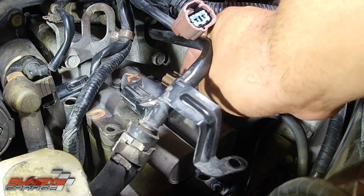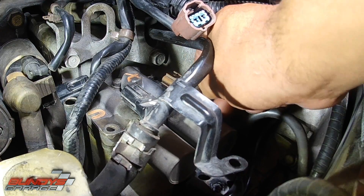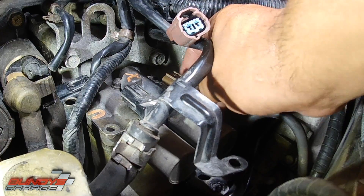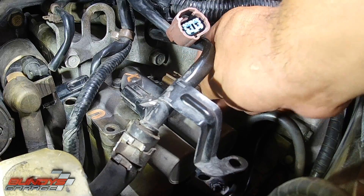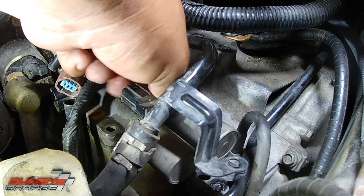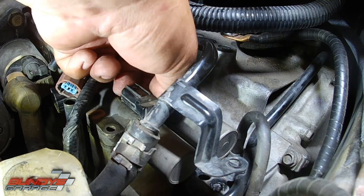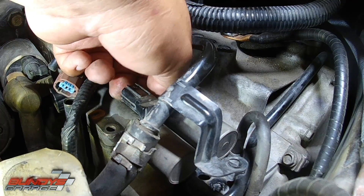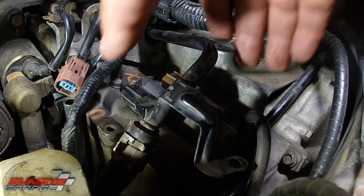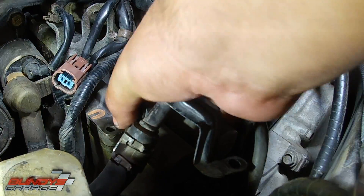I actually put a link in the description below to an article I found that talks about this specific problem. They're talking about comebacks for shop owners that rebuild transmissions, then the vehicle comes back again with the P0740 code. They talk about adding an external cooler, drilling a hole into the valve body at a specific location that helps with line pressure, and a new spring in the valve body at a specific place. So I'm crossing my fingers hoping this solenoid replacement will clear the P0740 code, but I'm not going to hold my breath. This transmission has seen better days — it's probably on its last leg. The P0740 is not the kiss of death though; this vehicle has had that code for three years with no drivability problems. It's not shifting hard, gas mileage seems fine, everything seems good. It's just this code keeps popping up, which makes it very difficult to pass smog out here in California.